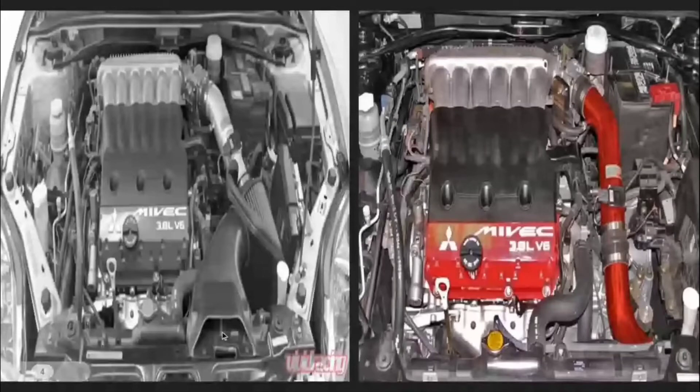Here's something you could do — on the left there's an option I should have done but didn't, where you keep the scoop and the little plastic guard to protect it from the heat. The only problem is I feel it'll still probably get hotter. On the right, this is actually a K&N cold air intake that goes down underneath the headlight, just like the NGEN intake. That's what you want, because colder air is always near the ground. Especially in an engine bay where the engine's on and hot — warm air rises. So if you have your cold air intake on the ground, the heat can't rise onto it, and you'll always be getting fresh air.